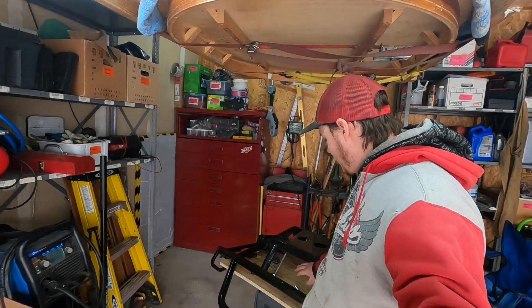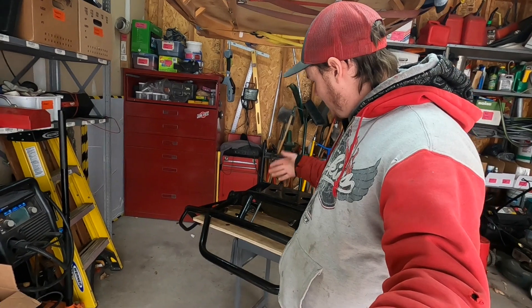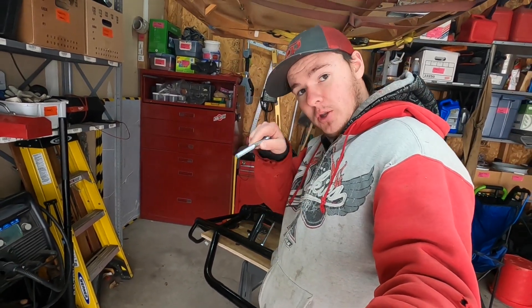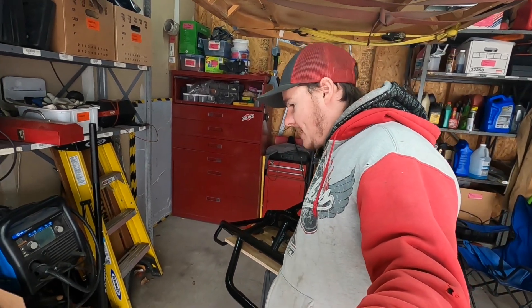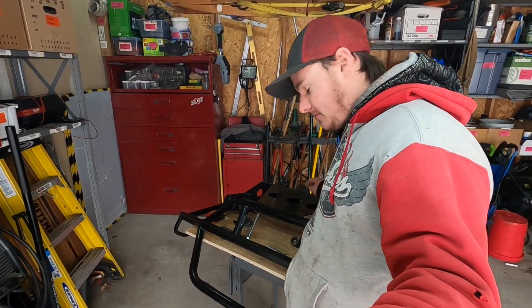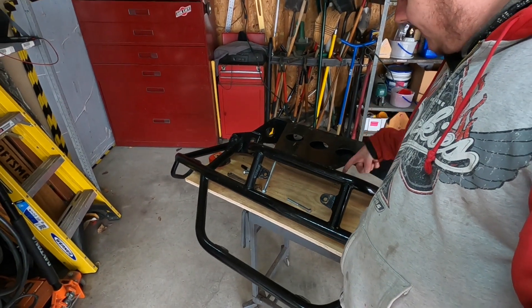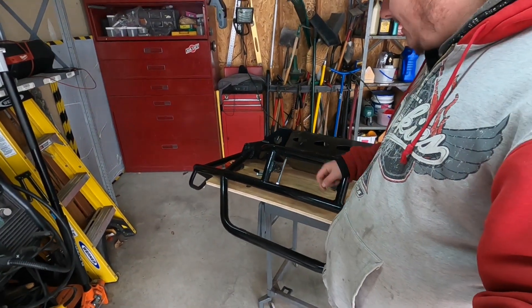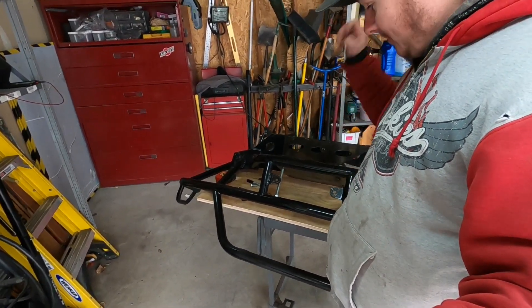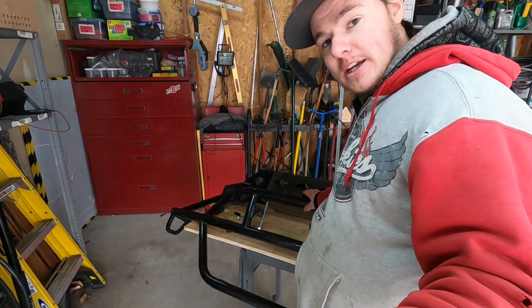I have the winch all off and everything taken off, and I figured out how much I need to move the winch forward. Unfortunately I need to fill all four holes, but I got two bolts — I'm gonna put them in the hole, weld it on both sides. I also bought a new sander that has a little finger that comes out so I'll be able to sand both sides. Then I'm going to re-drill it, get the winch mounted, and once it's all good on the winch end, I'm going to take it back off and work on light bar brackets.